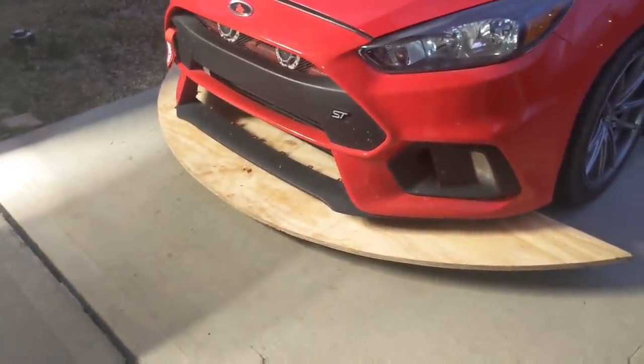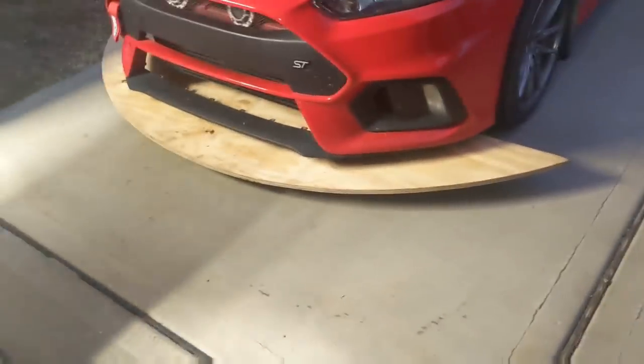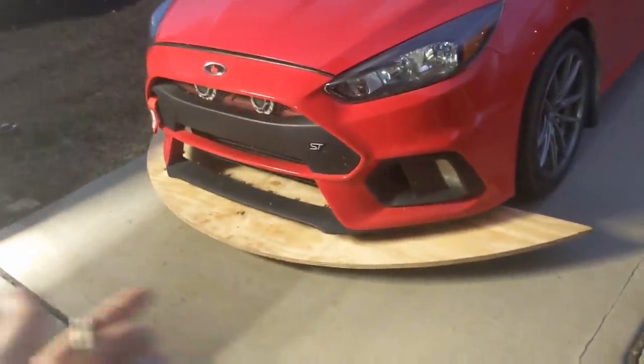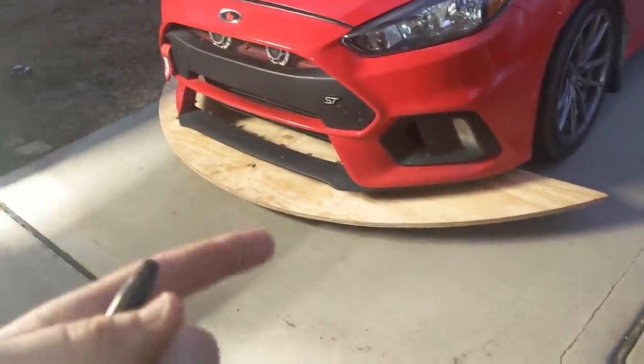So this is gonna be fun and exciting, guys. Follow me on this journey to make an under $100 chassis mounted splitter for our car. And you might say, why wood? A lot of companies use wood because it's durable. And honestly, it's not fiberglass, which is expensive and it's gonna shatter, or metal that's just gonna bend, so it's cheap to replace.